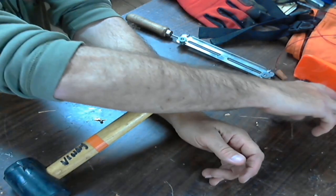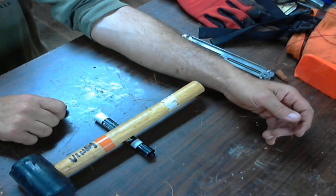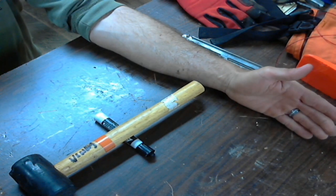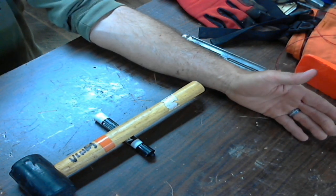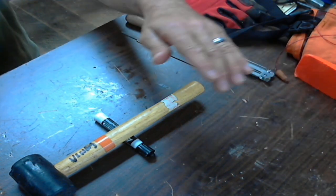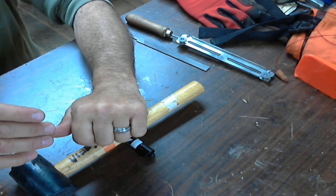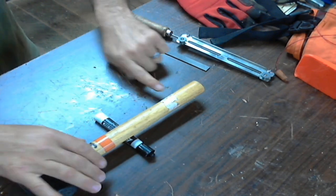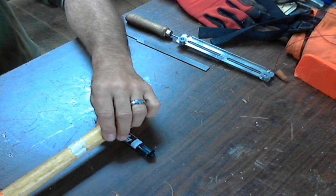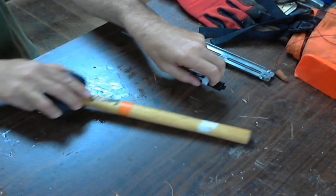It's also good to take something else, like a limb, and stick it under there, so when it does cut, it's falling on that. You don't have to keep cutting towards the dirt, because, like I said earlier, the biggest thing is keeping that saw sharp, keeping it out of the dirt. You don't want to be laying cable with your saw. It's not a Ditch Witch, you know. So anytime you can use a cant hook, or a timber jack, which is like a cant hook that has another rod on the end of it, so it props the wood up, try to get them off the ground as much as you can. If you can't get it up, roll it over to finish your cut. That way you're not putting that saw on the ground as much as possible.